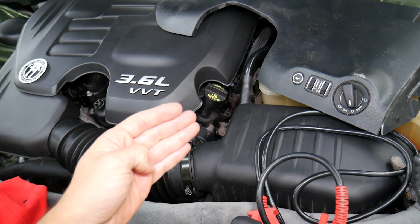If both headlights do not work, you need to check fuses again, but it could be a bad headlight switch in some cases too, because a bad headlight switch may not let the headlights turn on. If you leave them on automatic and they do not turn on, it could be the light sensor which is installed on the dash. We'll have a video how to replace the light sensor. And if you want to see where the fuse for the light sensor is located, again, check it out on our second YouTube channel, Electrical Car Repair Live.